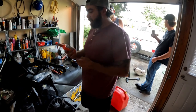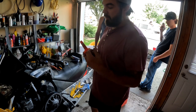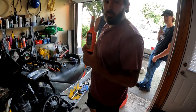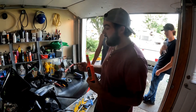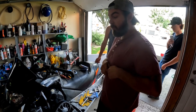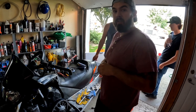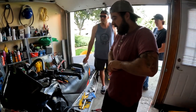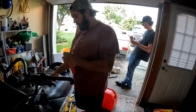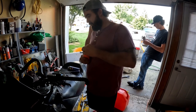It's not starting. I think we've got some skunky fuel. If you pull the plugs out you can smell the skunky fuel on them. So we've got some octane booster in high hopes it'll bring the fuel back to life a little bit — we did fill it up a little, but it's regular, so it's not going to boost that old stuff that well. It fired up really well when we poured gas down the cylinder, so we know it'll fire — it just needs a little bit of help. If this doesn't work, we're probably going to have to drain it out.